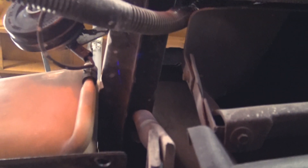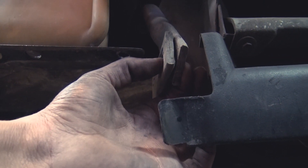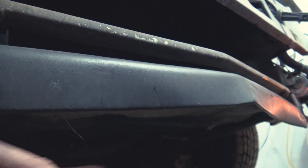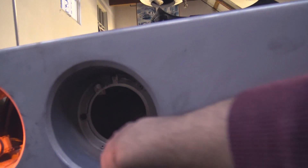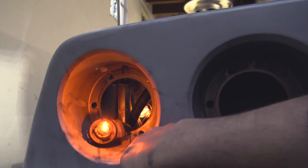That should be the final bolt holding the bumper, and the same one is on the other side as well. We're also getting the tail lights out — they're held on by two 10-millimeter bolts, one here and one over there.